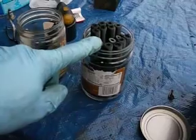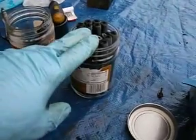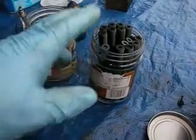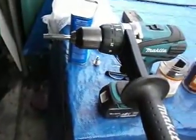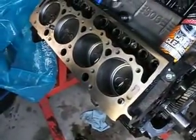Make sure you clean both sides. As I pull them out, I've dried them off and then blew them off with compressed air just to make sure they're dry. Right here I've got my drill set up with the appropriate tap and chased all the threads on the block.